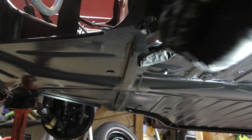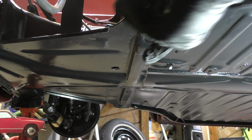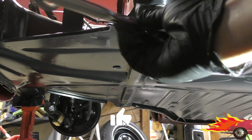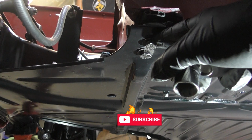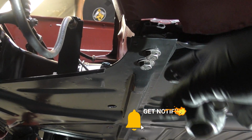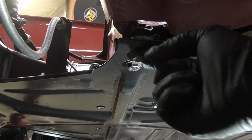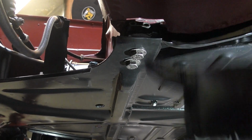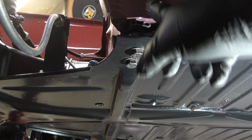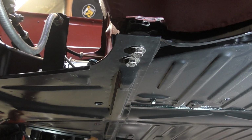Now these bolts under the Napoleon hat are probably the biggest pain in the neck to get on. You might have some blaster media stuck in there, you might have paint, you might have embedded rust. You should take a punch or a pin and wedge it in there and see if you can line up. There's a captive nut and bracket inside the body, and so the bolt has to fit through the pan and into that. So you might have to wiggle things around, and you might also have to run a tap through there to clear it out.